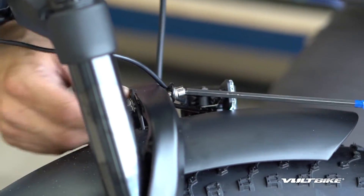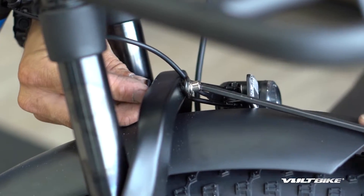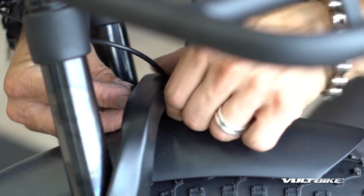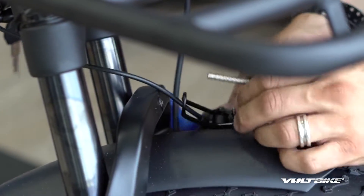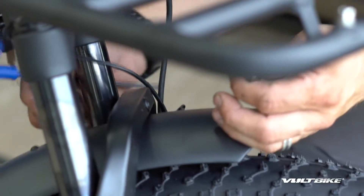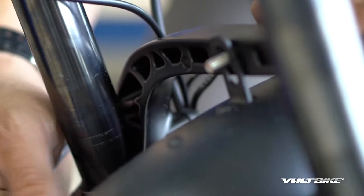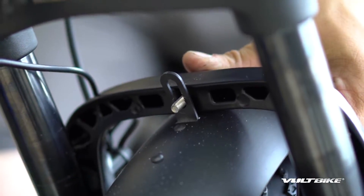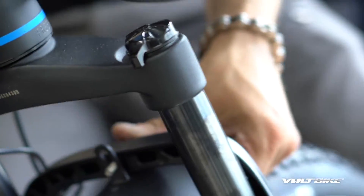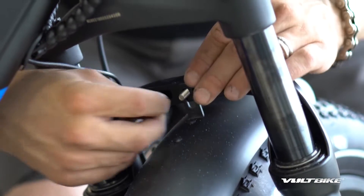Try to catch your parts as they come off. You can hold the washer and nut in your hand as you remove the bolt. Separate the light — you can see there's a little tab for the fender. We're going to reinstall that same bolt through the fender. On the Yukon I usually like it at the most upper adjustment point so that you've got clearance from mud. If you get the fender too close to the wheel you may get some rubbing.